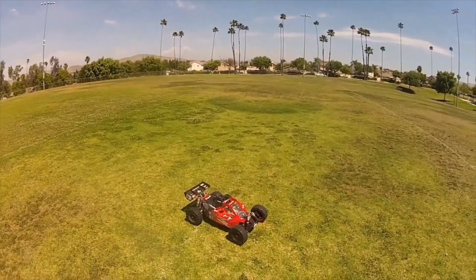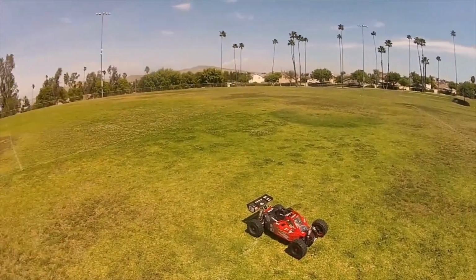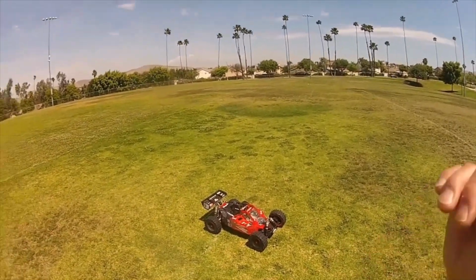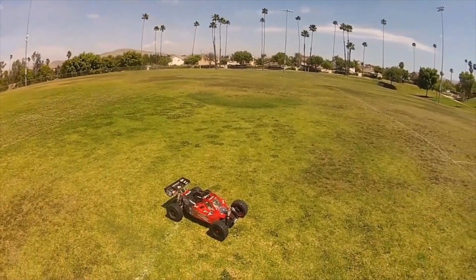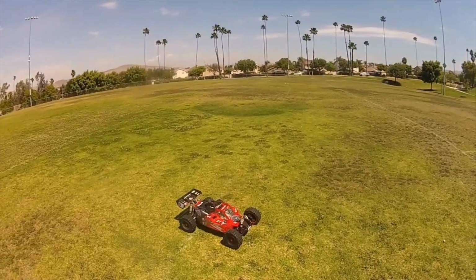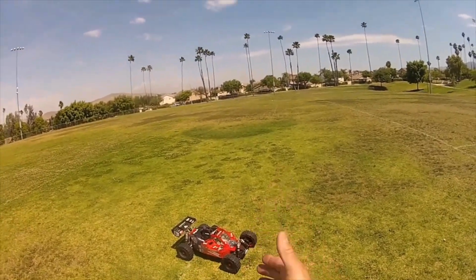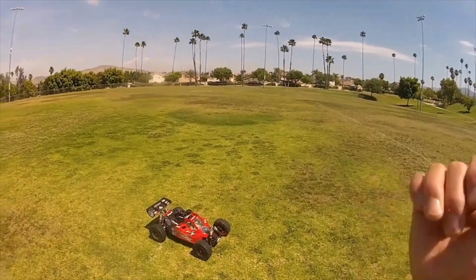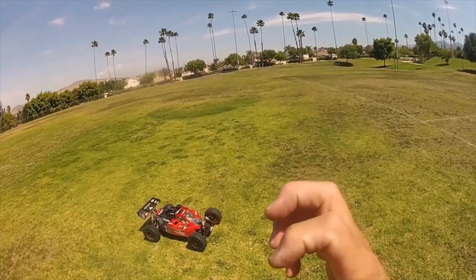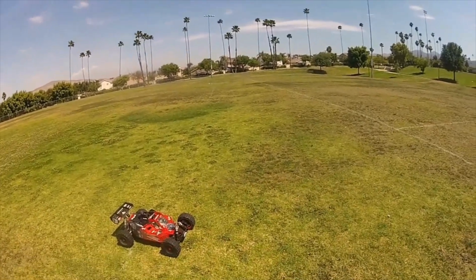This carburetor, 1242 modded. I've got the power stack on there, triple dome air filter, Signature Series 34 reed full mod, CNC balance crank, DLC coated, the whole 9 yards. Turtle Racing front clutch carrier, front and back, 2258 gearing, all the titanium, RC modded center diff, which by the way, I've got my RC modded center disc brakes, billet brakes, with the boots that go over them so you can keep your outer drives lubricated so they last longer.